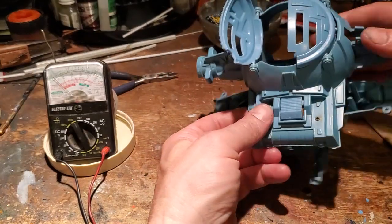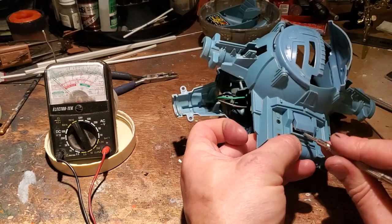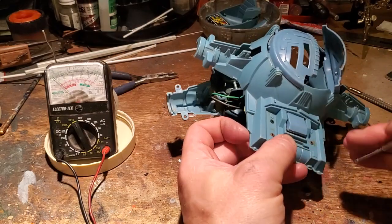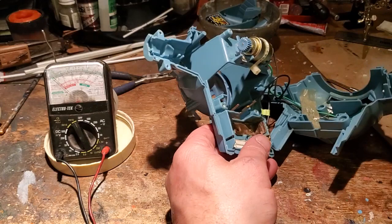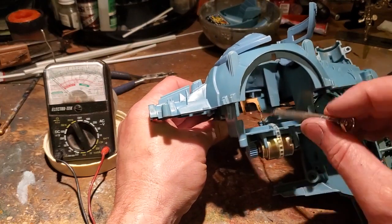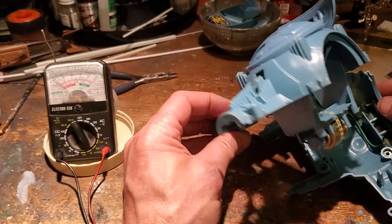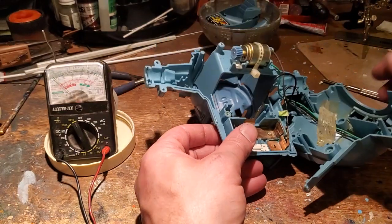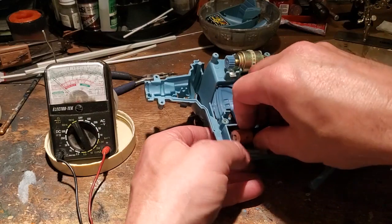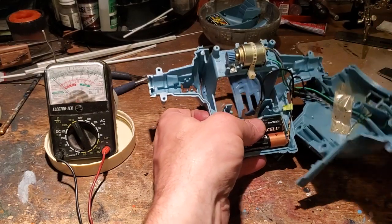What I ended up having to do was carefully take this screwdriver and go underneath that tab, then start scraping away at that copper. I could literally hear the corrosion go 'tsss, tsss, tsss' as I was scraping away. You can see there's the plastic piece and this copper piece with a plastic pin that fits in there — I didn't want to risk breaking that plastic, so I just scraped underneath. Then we put in the batteries and we should have sound — and we also have a light.